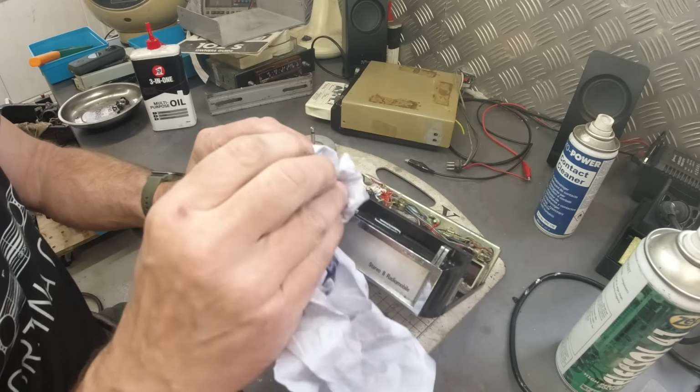Lid off to get the underside, some rust there. Motor then. I think, oh yeah, there's that spring and it's damaged, so we need to repair that. So we've got to take this spring off here. That's going okay. This copper spring is damaged. It looks deformed, the wrong shape. It's kind of catching on the cam, stopping it changing tracks smoothly. So I'll take that off.